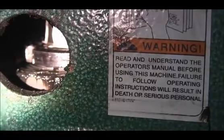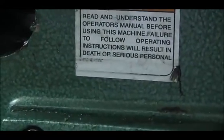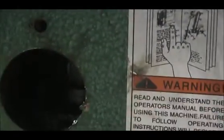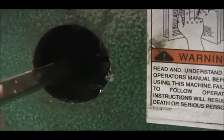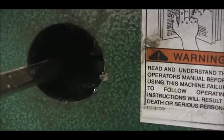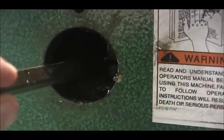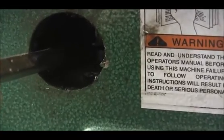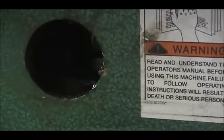You need to bend that tab down, and I use that hefty screwdriver to bend it down. Then the procedure to tighten it is to stick your hefty screwdriver into that space — the appropriate place on that nut — and then gently tap that spanner nut to tighten it up. That will suck those bearings up and give them a certain amount of preload.